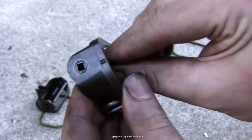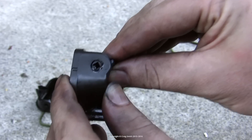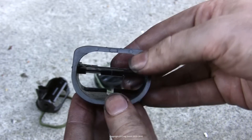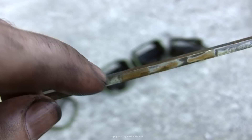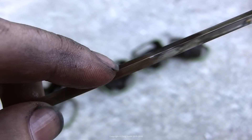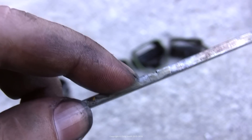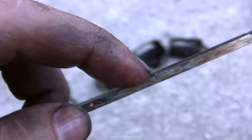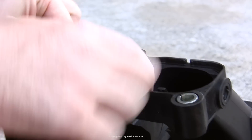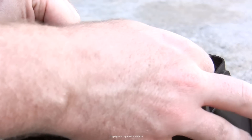Here's a look at a few of the removed flap assemblies — they're covered in penetrating oil, just ignore that. Notice the wear around the plastic bearing that's moulded into the surround, and notice the movement possible in the ones that are bad. What's really interesting — and the dangerous bit — is the rod. This is a 3.5mm square rod, probably stainless steel of some grade. Look at these specific locations where there is really interesting wear — it looks like cuts, almost like somebody slipped with an angle grinder — and it's rounded at the end as well, on the side opposite the actuator. The final pieces in this puzzle are two bushings or cylindrical bearings hidden between inlet tracks 1 and 2, and 3 and 4 respectively.